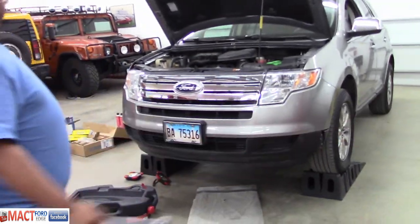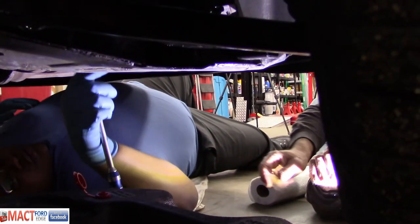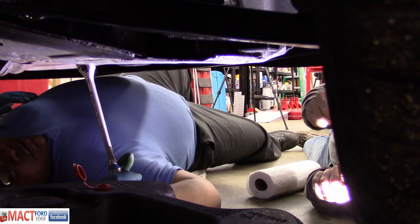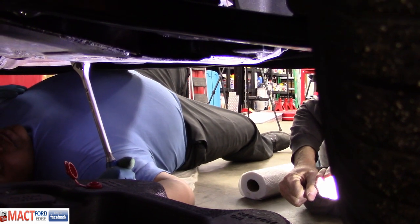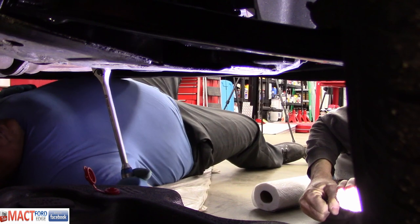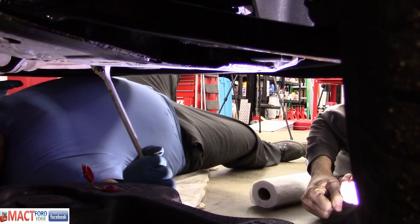All right. Hold on a second, Antonio. Get over here. Do you have the ratchet on loosen? All I want you to do is break the torque on it. Okay. Come down here, we've got some leverage. Make sure it's good and solid. Don't strip it. Yeah, okay. Just hear it pop. Just crack it open. They probably did some oil changes before. Yeah, they tightened that thing harder than crap. Keep doing it. There you go. A little bit more. You want to be able to loosen it with your fingers.